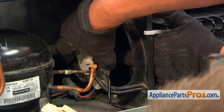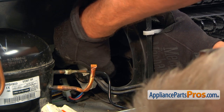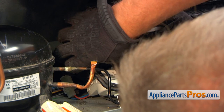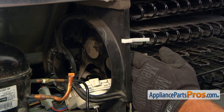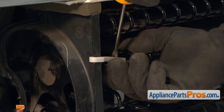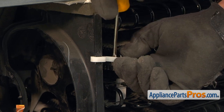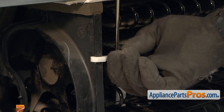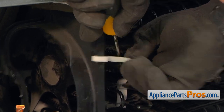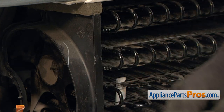We need to free the blade completely from the motor shaft. I'm going to push it down a little bit, turn it, and we can put the motor down. Next, we need to remove this plastic retainer. So I'm going to open it up with a flat blade screwdriver and remove it from the coil and then from the housing. Put it aside.